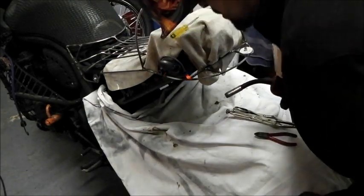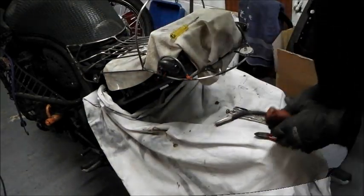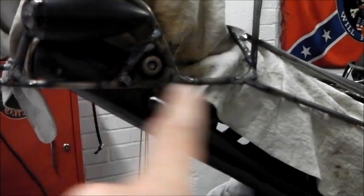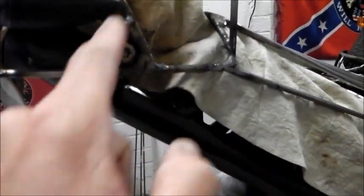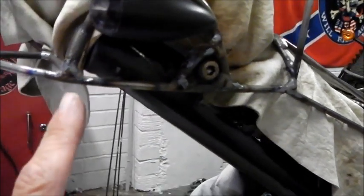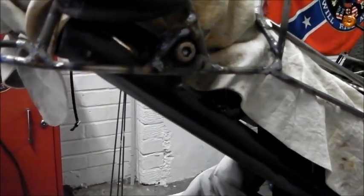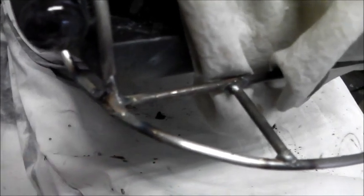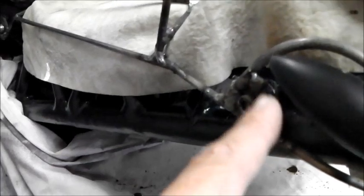Fire out, Skipper. Now, ugliest thing, because I want loads of strength in there, so I put a triangle piece across, and that's then the mount beefed right up to hell, and then a really strong piece of steel over, and a good beef weld on that side as well. Just over welded it, all three sides. Same as that one. Even there. Loads of weld. Just built it up, and built up a big triangulated weld.